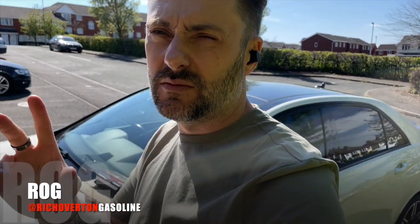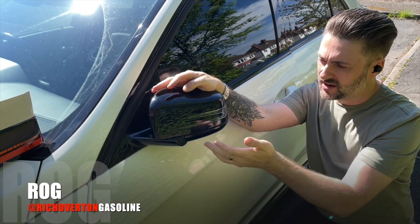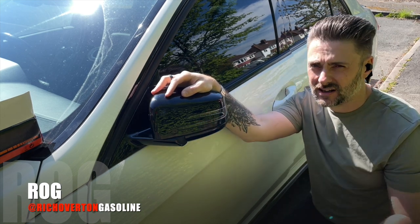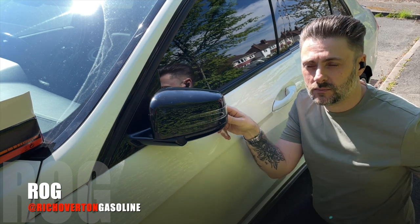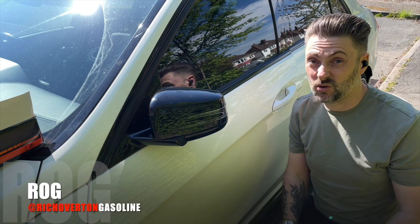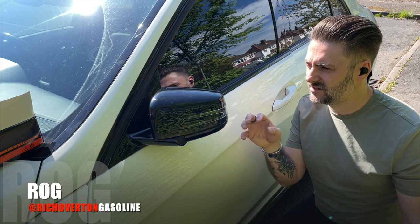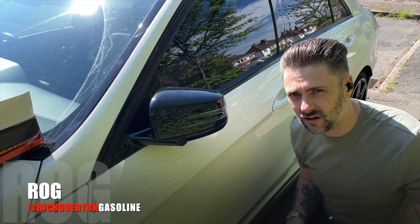It's a straightforward fit with no modification in terms of the wiring — it just goes straight on. You'll need to open the car and get the mirrors to fold out. It literally is a bit of force and these pop off. You don't need any leverage really. If you can't get it off, you can use a pry tool. The kit comes with a pry tool, but I used it on the other side and it broke, so it's a bit pointless. It's just a case of a bit of force, but obviously take your time.